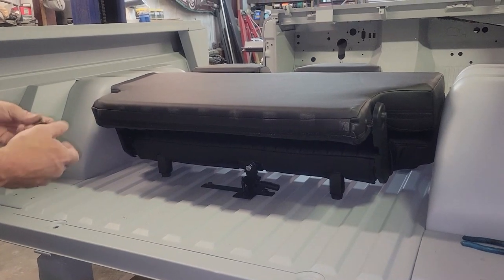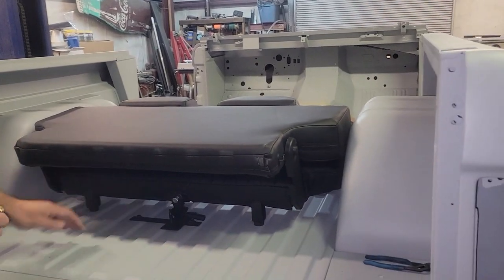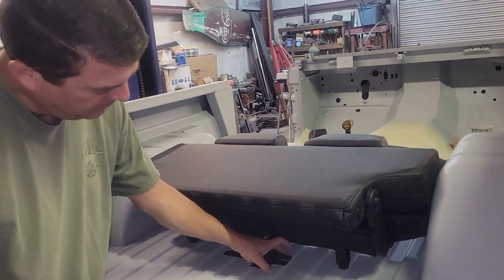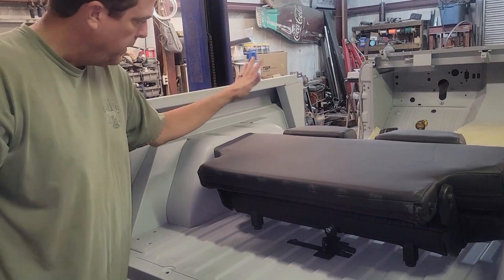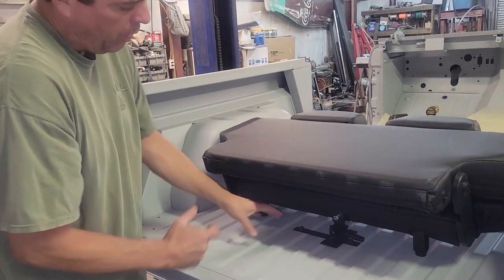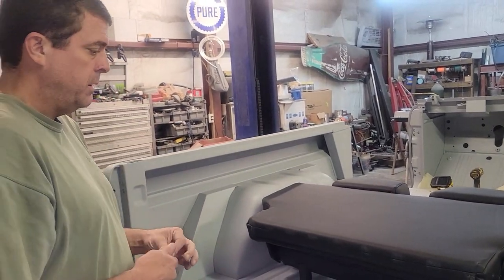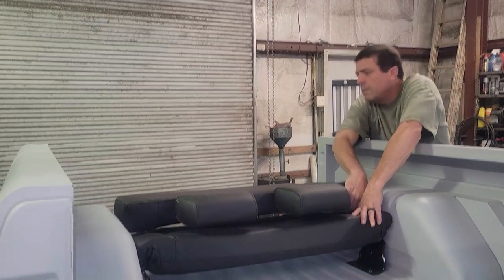I'm not putting it together fully right now — just one bolt on each side at the front, and the smaller bolts at the back. That back location is also your seat belt mount, where the seat belts come through and tie in. I'll need to cut wider plates — basically large washers — to strengthen that section underneath the bed where the seat belt is, and use grade 8 seat-belt-grade bolts. Let me tighten it down a little so we can operate it and show you guys what it looks like.